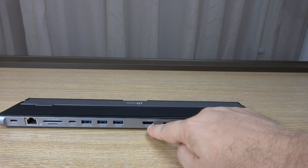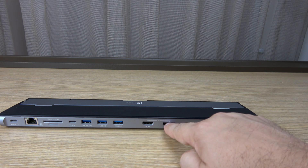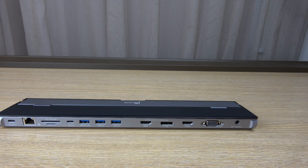In this situation, you either have to pick HDMI or DisplayPort — one of the two — plus HDMI and VGA. So it will not support all four at one time, even though some laptop video cards may be strong enough to handle it.